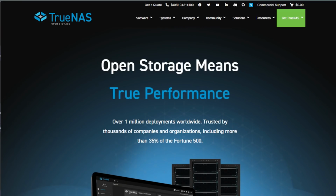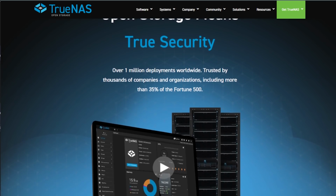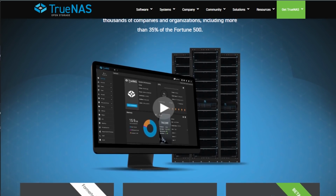Cast off enterprise equipment. You can save it from the dumpster, you can save it from the landfill. I definitely saved my fair share of hardware from the landfill, and you can run something on it like TrueNAS and have access to a lot more functionality than you used to. If I wanted to keep running the LSI stuff, the NetApp stuff from IBM, well, there'd be licenses and questions, and it wouldn't run quite as well. I can put faster hardware in front of the older disk shelves, and the whole thing actually speeds up.